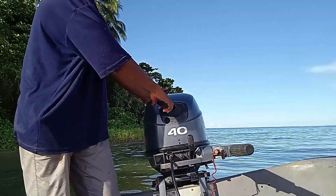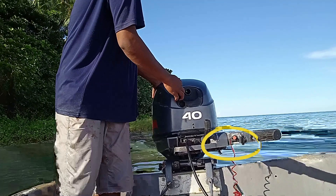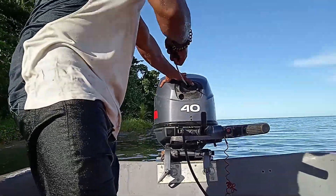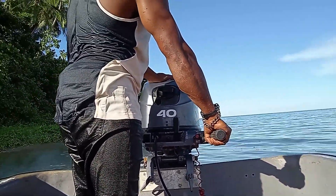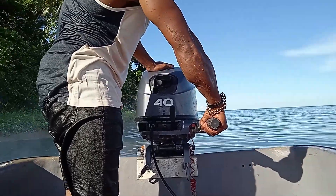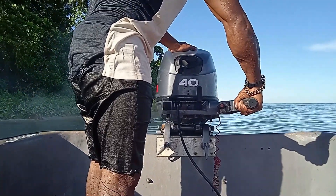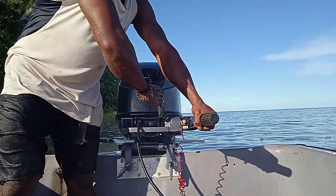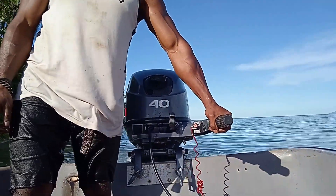The clip is attached to the engine stop button before the engine starts. Pull the manual start button to start the engine. If the engine starts easily, allow a three-minute warm-up. Then push the gear lever forward to take off.